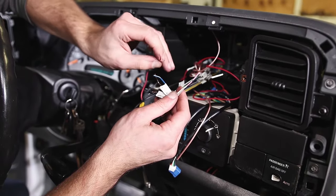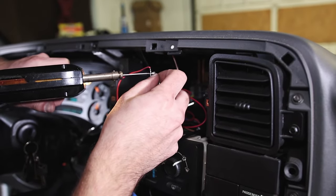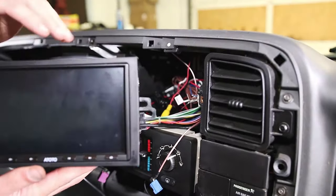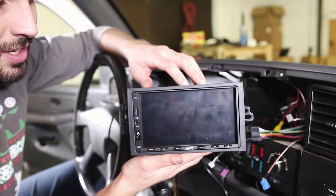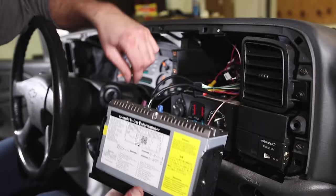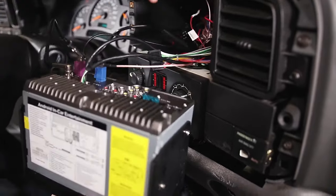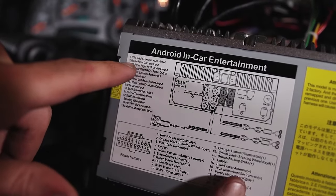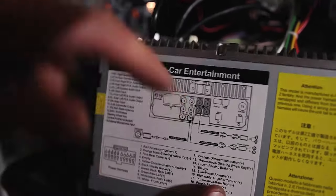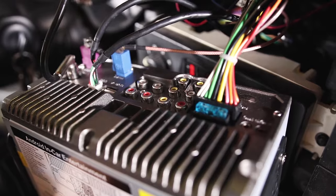We're going to be connecting the red wire from the rear view camera to the pink wire in the head unit harness. Now just reinstall the head unit — if you're interested in learning how to install this head unit, we do have a video on how to install the Atoto A6 Pro. Plug in the external USB ports, the GPS, the Wi-Fi, the radio antenna, and the video feed. When plugging in the camera, look at number two on the left — it says RC in, rear camera input. On the back it says top yellow one next to the right, the audio input — so plug that in.